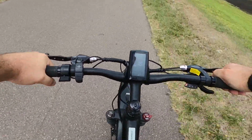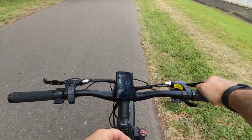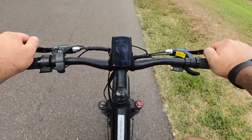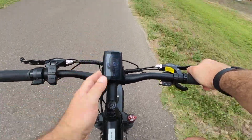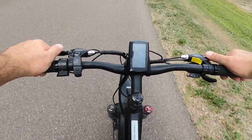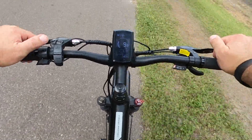All right, so we're on PAS 1. I know it's kicked in and I can feel a higher power distribution in PAS 1 for this, but the increment's not bad. Like I mentioned before, I have electric bikes, and I tell you, that power allocation at 20% or above on PAS 1 really sucks. This doesn't jerk you out as much. If it was on 1 through 5, I believe the power distribution for PAS 1 would be higher in percentage, so this isn't bad. And I'm thinking less about the Himiway's ability to assign the percentage level for each PAS setting.